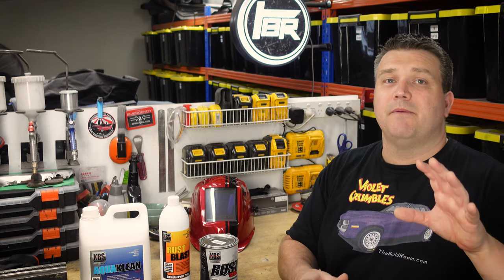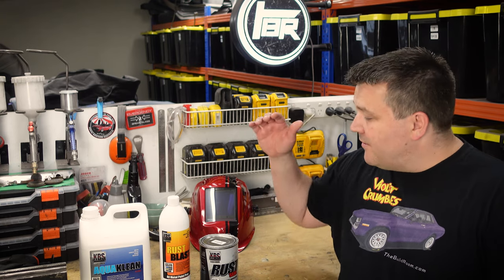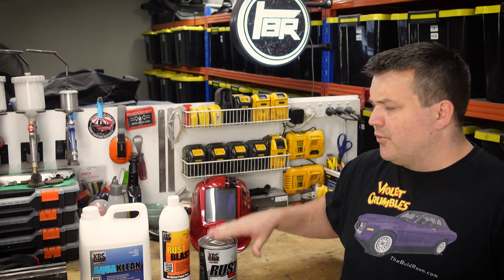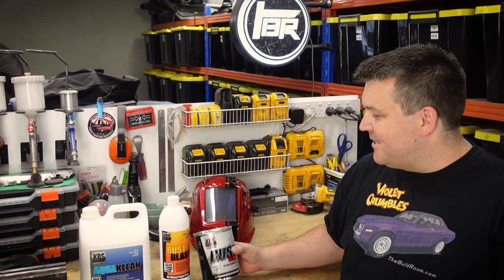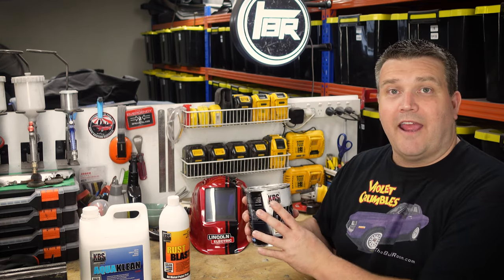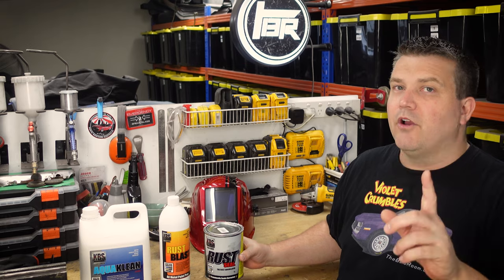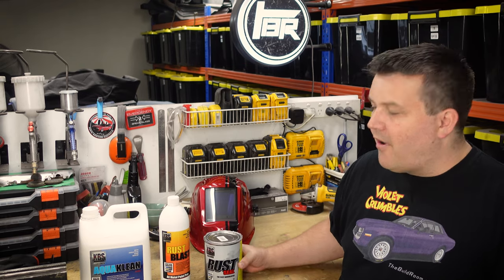All three of those things have just been forcing water into that cockpit for a while, and I wanted to make sure that it was just really well protected moving forward. In terms of the rust seal itself, I was really, really impressed with this. It's kind of like painting with maple syrup. Now, this is a liter tin and I only used half of it. So I did the entire interior. I only did one coat, but I did quite a thick coat with 500 mil.